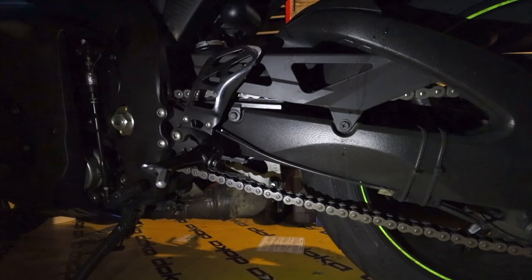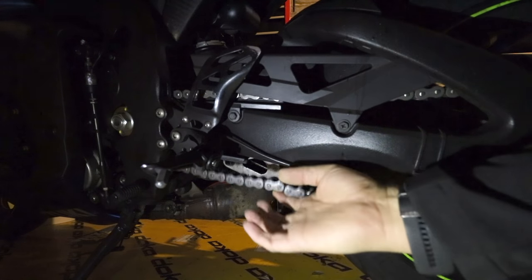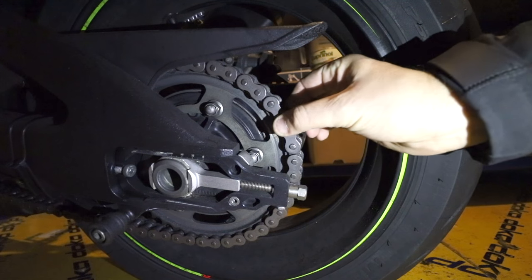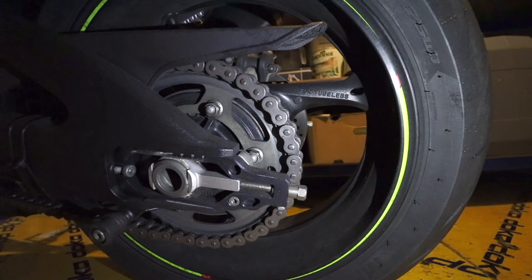The chain's quite slack. Some people don't know how to do it, so I may as well just run through quickly how to do it. Two minute job. How do you know if your chain's too loose? Well, look — way too loose. And another good identifier: this is pretty dangerous. If you can actually move that off your sprocket, it's too loose. Which we need to tighten up.